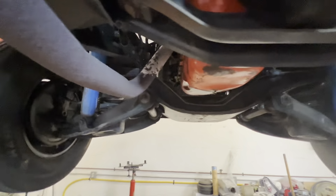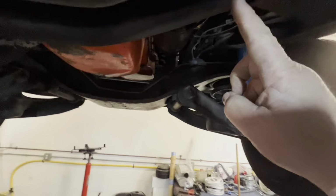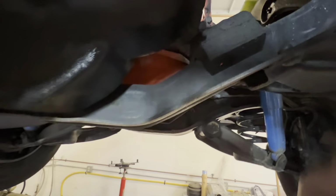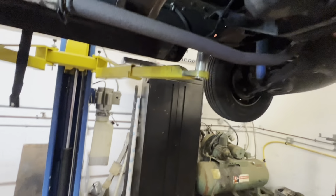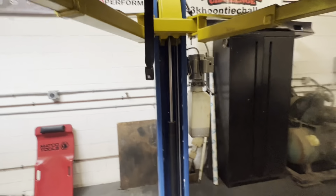I was thinking one bolt there, one bolt down here, but it looks like all that is inside. Yeah, those bolts come from the opposite direction. So two bolts from this side, two bolts from in the bell housing, which means these mount bolts and then the bell housing to get the transmission out. But either way, this has to go. So let's make it go.